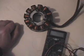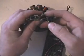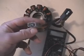This stator is actually very easy to check as far as ohms and resistance. First thing we'll check — we've got two plugs here. The four-prong plug on the right is what plugs into your wiring harness. You've got your two yellow wires for power, and the other two are your ground and common, basically for your ignition switch, turning the sled on and off. The other plug, a white plug, is your ignition plug that goes to your CDI box.